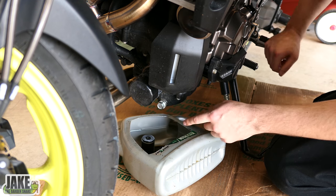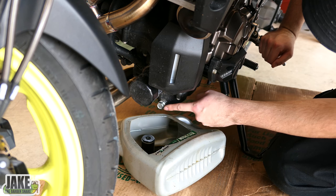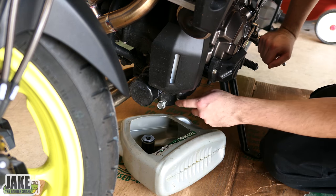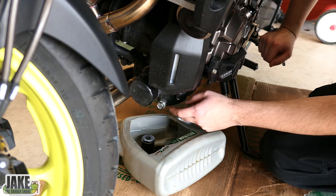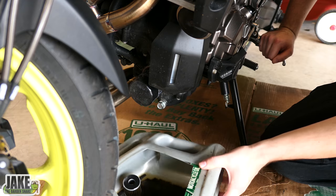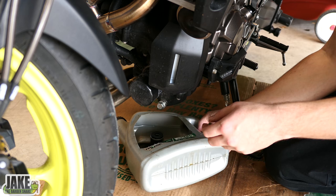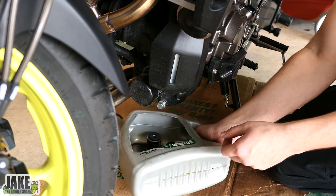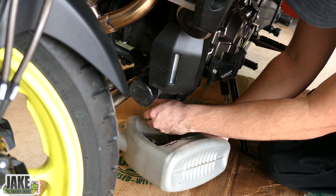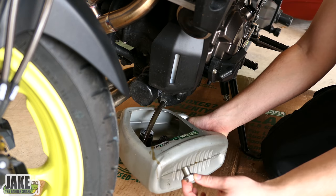One thing that's nice to look at here — you've got to see if your crush washer is sticking to your motor or staying on the bolt. In this case it seems to be stuck to the bolt. If it was stuck to the motor, before I get it all the way off I usually like to get my fingernail in there and flick it forward, because what ends up happening is the oil is dumping and at some point it'll fall off into your catch container. There's actually a handful of crush washers in there but it's just something I like to do. Right before I take this off, I'm going to hold this end up — because there's a good chance the bolt is going to try to shoot forward, so being ready for that is not a bad idea.